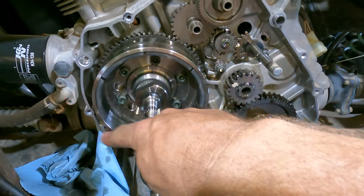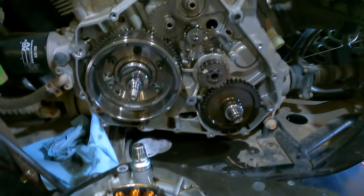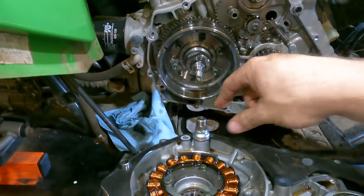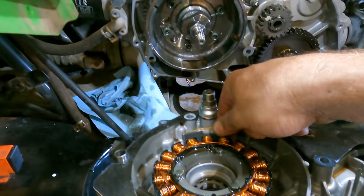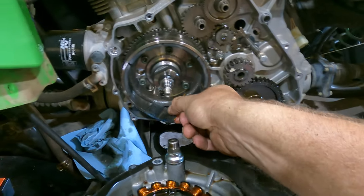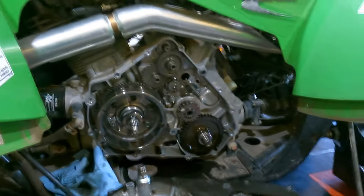Usually they start sliding together leaving a pretty big gap. So basically I take out all eight - six by 1.0 bolts here, six by 1.0 bolts there, and then the big guy right here - I think it's an 8mm bolt with a 12mm head. You pull that apart and we'll go ahead and order up a new rotor. The stator looks fine, I don't see any damage on the stator anywhere. But again, that glue goes bad and it creates these huge gaps, and that causes a no spark issue.